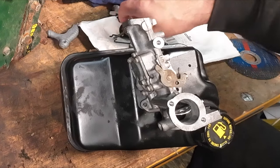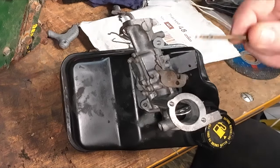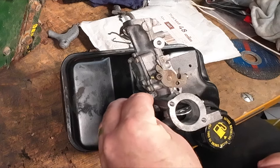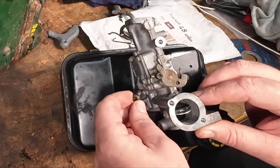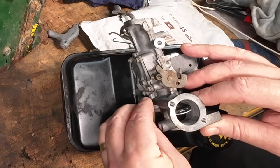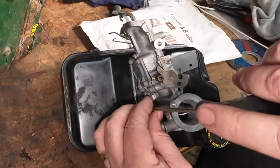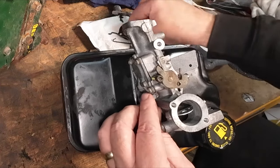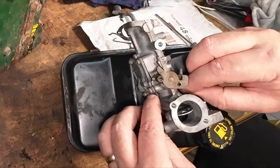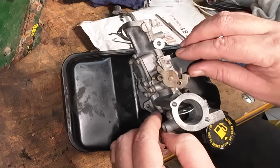You've got a couple of Torx screws to put on, which will actually go into the tank, and then you've got this long one here which will go all the way down through the centre. The first two you want to do is that one there on the front — just line it up, line the gasket up. There's a second one here to put in on the other side. And then the two that go over this side here — they're the ones that the choke lever sits on. So I just thought about this gasket because it's not quite lining up.